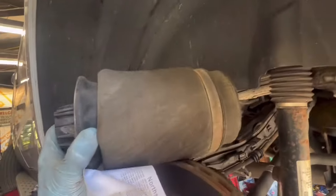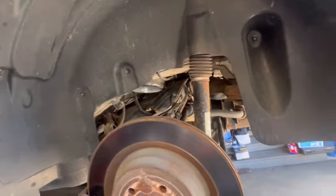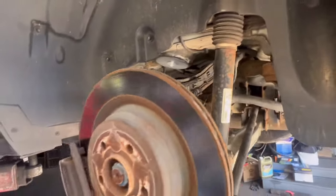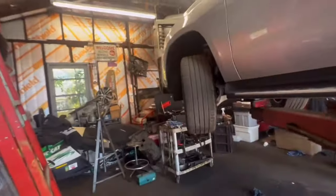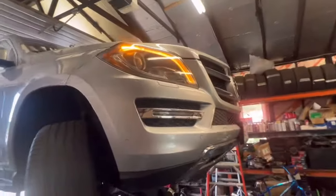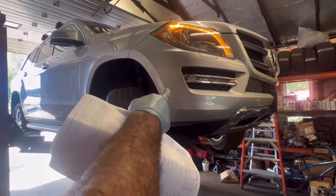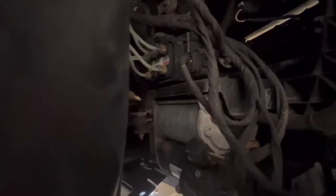So this is the air bag, which is not leaking — nothing around it. I have a new one but it's still not working. The problem is the pump is kicking on. Since the pump is kicking on, that's the good part — it's not leaking. For this vehicle, the suspension pump is located on the right front. You remove this cover — a couple clips, 8mm — and it's right here. This is the pump, and this is the valve. See all the hoses? This is the expansion valve block.